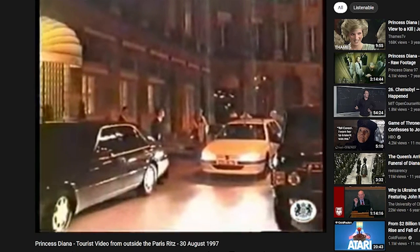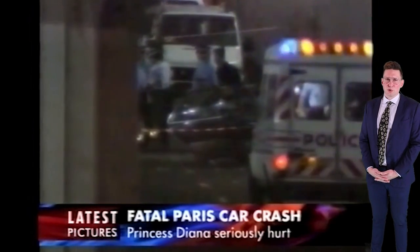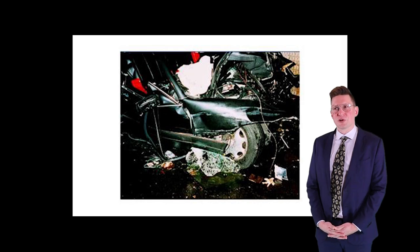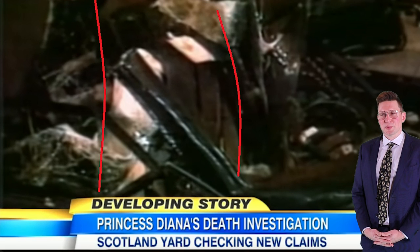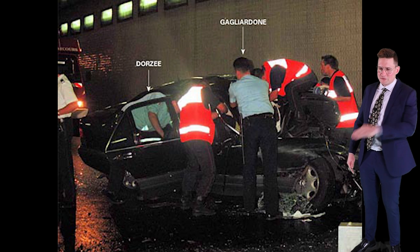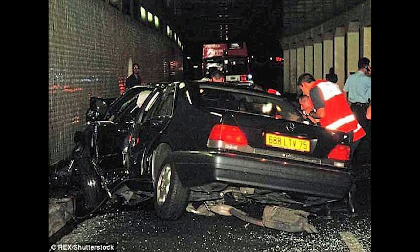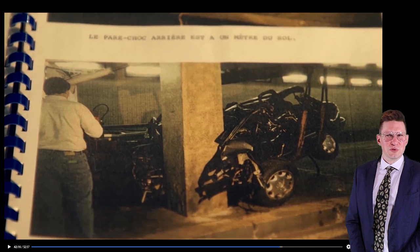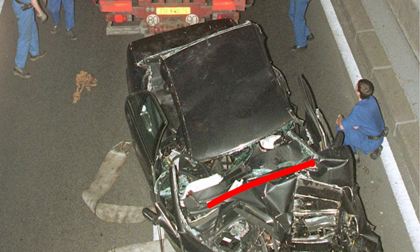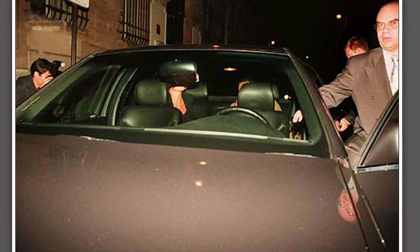Which is why on August 31st, 1997, French doctor Frédéric Mailliez was able to simply open the door and provide aid to a living and responsive Lady Diana. Crash test footage is always conducted at 40 miles an hour — beyond that, with every additional increment of speed, things become really scary really quickly, and the results become exponentially more dire. At real highway speeds it's not severe chassis compromise; it's complete destruction. That S-Class hit that concrete pillar at an estimated 85 miles an hour. Had it been any other 90s vehicle, there wouldn't be survivors. Road Fortress did its job — the A-pillar looks intact, there seems to be no cabin intrusion, and the engine literally pushed underneath the car, which is where it's meant to go. The most common photos are the ones after they used the jaws of life to chop it up. The driver and the man behind him were pronounced dead on the scene. The front passenger survived. Lady Diana was rushed to hospital where she was pronounced dead about two hours later.